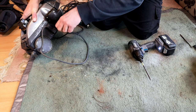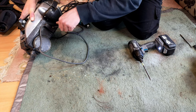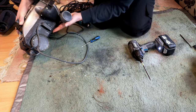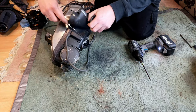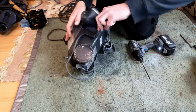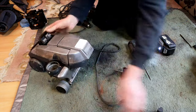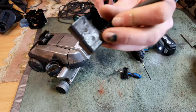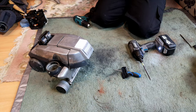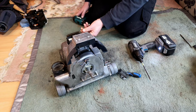The cable is now removed. Oh, you're a crosshead of course you are. You need to be almost user-replaceable but then you've got to go through two Torx to get here. We'll take this off with our flathead screwdriver. Oh my goodness, are you really going to fight me to the last thread? This should pop out - it's dripping wet, all the water is under here. And then we can take our cable out. Nothing wrong with the cable either, bar it being absolutely soaking wet. That can stay in a warm cupboard for a couple of months.